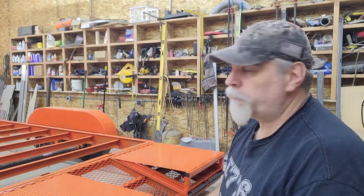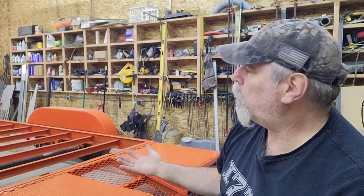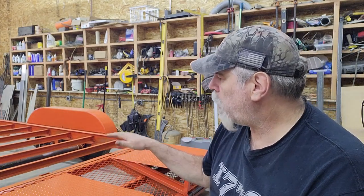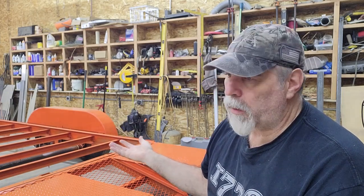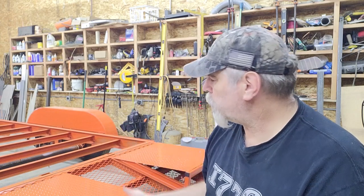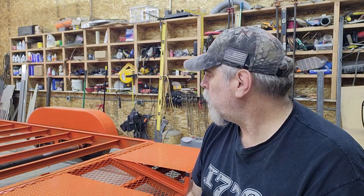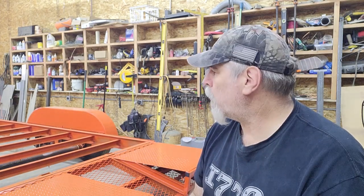So on the electrical, I'm going to lay everything out, but the way I'm going to do it, instead of trying to hold everything underneath where it'll mount, I'm going to lay it out on top, in essence a mirror, an upside down position. That way I can lay the J boxes right on the cross members where they'll go. I can lay out all the cable and the wiring, get it cut to length, and then it'll just be a matter of scooting that underneath and bolting it into place. So it'll be a little bit easier to cut all those lengths. Anyway, I'll set you up for a time lapse on that, and then if there are particulars, I'll bring you back and we'll talk about some of the particulars of trailer wiring separate from that.